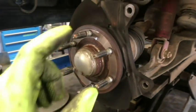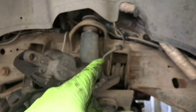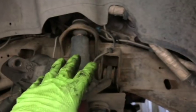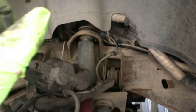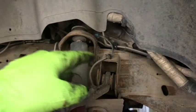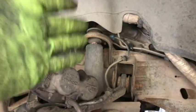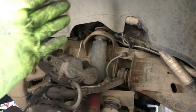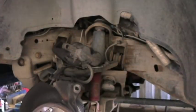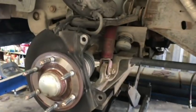I don't trust it. You most certainly don't want to put it on the spark plugs that go into an aluminum head. Now back in the day they used to do that to cast iron, but cast iron, when you would have a bunch of rust, it would make it damn near impossible to take them out without breaking them, so they started using anti-seize. Nowadays people putting anti-seize on these spark plugs going into aluminum heads, you lose the conductivity and you can cause a misfire, especially if you overgob the crap out of it. So I'm saying, look, unless you live in the Rust Belt, and we're gonna ask a Rust Belt mechanic later, I would not recommend using anti-seize on anything. Just put it in dry, leave it dry.